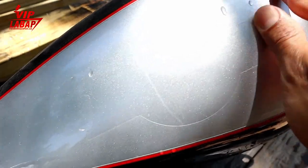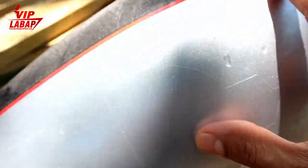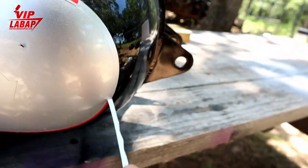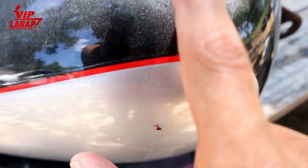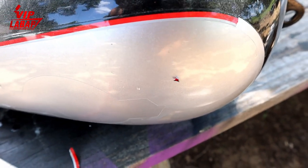We can feel the clear on the outside — really weird how they did that. So they sprayed the base, put the decal on, and cleared over it. I was able to peel the decal off, but this pin stripe here — they put it on and cleared it, but with a very very light clear coat. They based it, put the pin stripe on, and I can't believe how thin of a clear coat they put on.